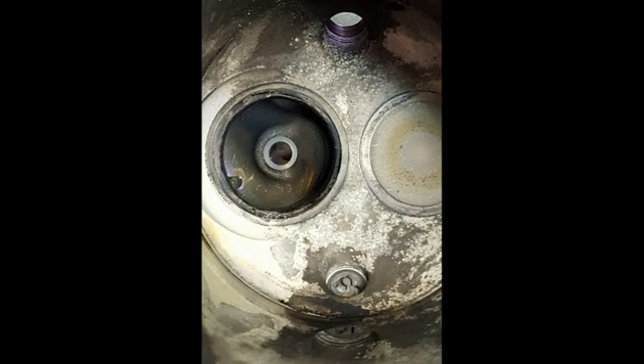Here we're looking down into the cylinder towards the top where the springs had been attached. On the left hand side is the intake valve area with the valve removed; the right hand side is the exhaust area where the valve is still in place. Top and bottom you'll see smaller holes — that's for the spark plugs; the bottom hole still has the spark plug within it. Looking around the left intake area, you'll see it needed grinding — it's not clean and the valve wasn't sitting properly. That's where we had the lack of compression originating from.